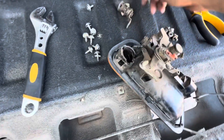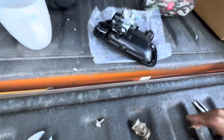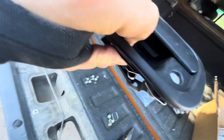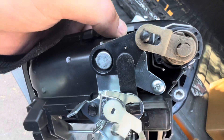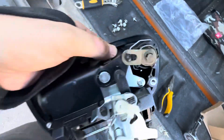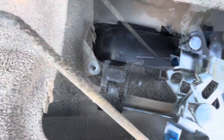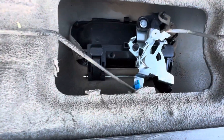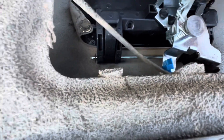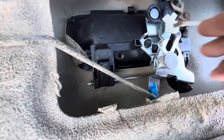So you're going to want to hold on to this lock. The new latch should come with another clip. Now you're going to want to slide your lock back into the new one here, and make sure the clip is holding it in so when you're installing it, the clip doesn't just fall out. Once you've got it in, you're just going to want to put in those 10mm bolts into the fittings. When you've got the whole thing securely fastened, you just want to put these arms back into their little slots — they'll just pop in and latch right to the arm.